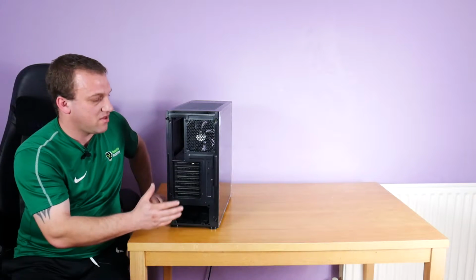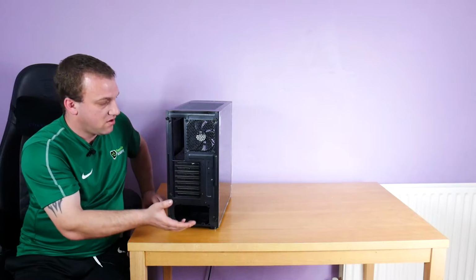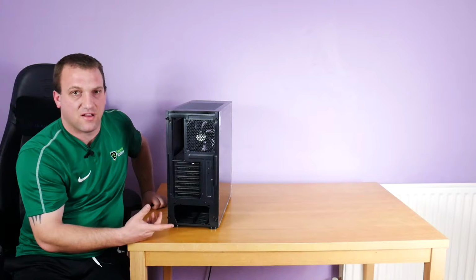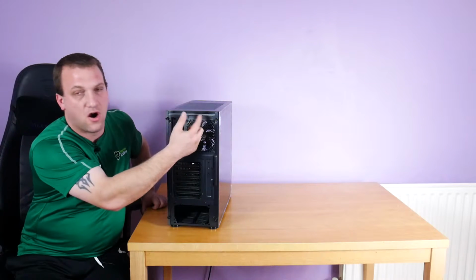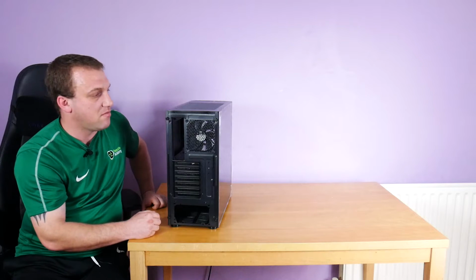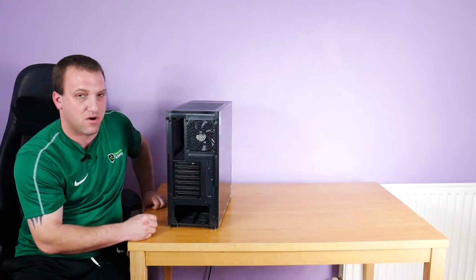It's a bit of a shame because with the mounting they've also gone for the standard single holes, where they could have gone for the slide mounting, which would have allowed you to push the fan up or down just a little bit depending on the hardware you're installing. Sometimes this can be of great benefit. Say sometimes something might be hitting your fan. Well, if you can knock it down a bit, maybe your AIO hose is up top there, so you just want to drop the fan down just enough to sneak that hose over the top of it. It's a really great feature, and it's a shame that Thermaltake has not included it with their Level 20 MT. But hey ho, we won't hold it against them too much, but it is something worth mentioning.